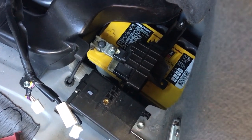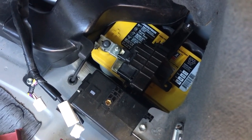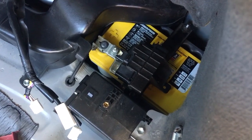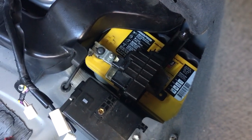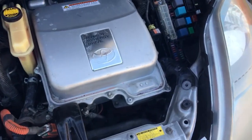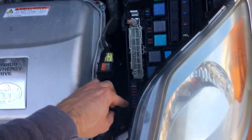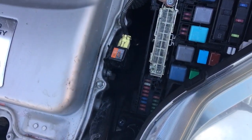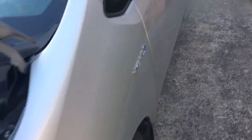Your pump will be working and you'll be back in business with your Toyota Prius. I just want to put that out there — no one has made a video like this all-inclusive with all the features. I've learned from other videos and some had really good ideas that I used here, so I want to give them credit. Nevertheless, this is how to get your pump replaced on a 2008 Toyota Prius. Check your coolant for turbulence, put your hand on the pump in electric mode, and know how to clear your red triangle.